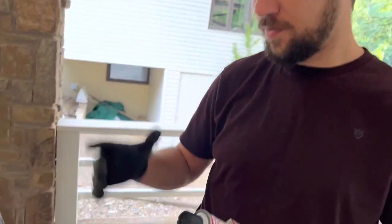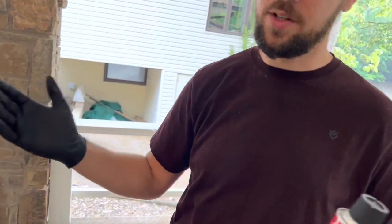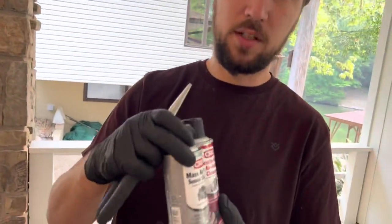All right. We've been having our engine light come on, and it's either been an airflow error code, mass airflow sensor keeps tripping. So as a first step, and it's been hesitating, a little sluggish on the start sometimes, accelerating is a little sluggish. So I'm just gonna start by trying to clean it. It is a 2013, I don't know the last time it's been cleaned. All you really need is mass airflow cleaner, boom.